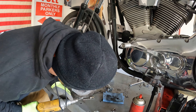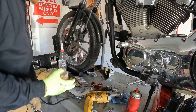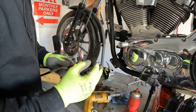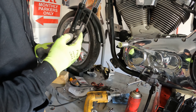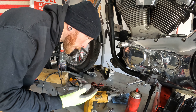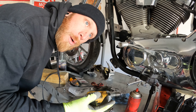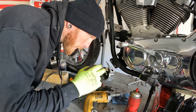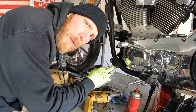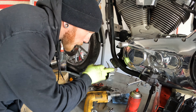This drill is just not fast enough to power this carbide bit. I didn't realize I wasn't recording, but you didn't miss anything because I didn't make any progress anyway. I've been working at it with the Dremel — it has a pretty good carbide bit on there, it ain't brand new but it's still a good bit. Won't touch it. My drill bits won't touch it. It's got to be a stainless steel bolt in there — it's super hard, I cannot get a bite on it. I've got some better drill bits at work, I'm going to bring them home and try to get that thing ran through there. I can already see the condition of this hole — I'm going to have to helicoil it, which isn't a big deal, but I've got to get all that crap out of there.